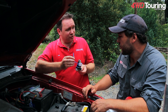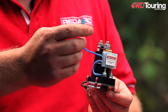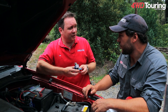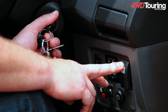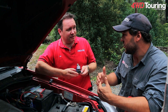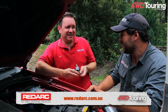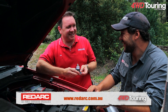There is an additional feature too with this blue wire — you're able to actually jumpstart yourself. So that means that should your start battery go flat, perhaps you've left the door open or someone's been listening to the radio all night, you can actually click it in and start off your auxiliary battery. So that's just like a temporary bridge that you can override. That's much better than having to ask your mate for a jump every time you do something stupid — save that stupidity and jumpstart yourself.